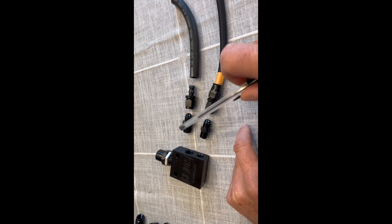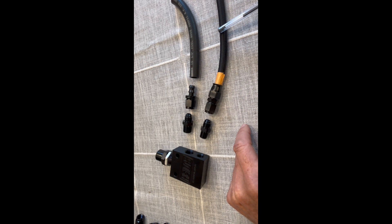To summarize: three-eighths inch high pressure PTFE hose into a PTFE fitting, into AN6 female, into a male AN6, into a quarter inch NPT into the PS101. For the return: fuel hose three-eighths to a three-eighths barb, to AN6 female, to AN6 male, to three-eighths NPT into the top port.